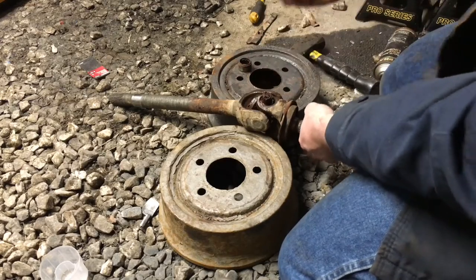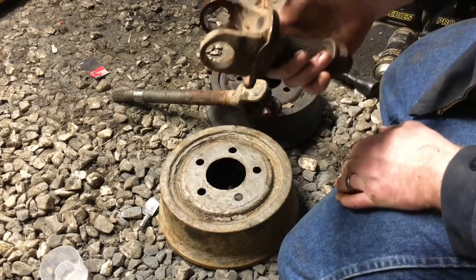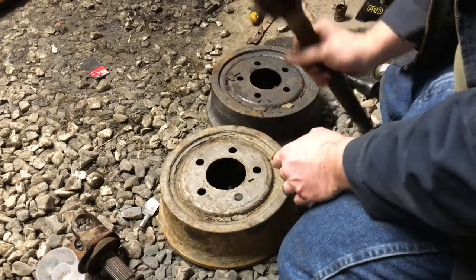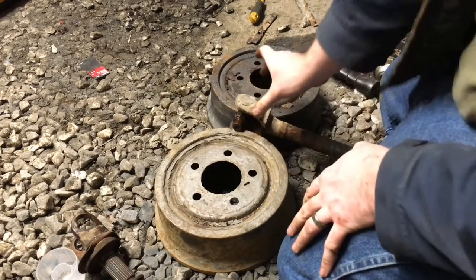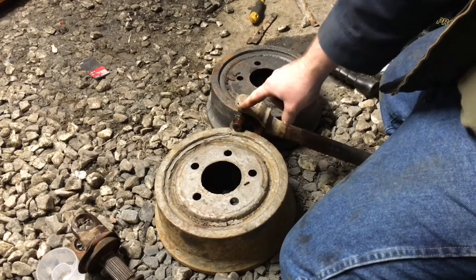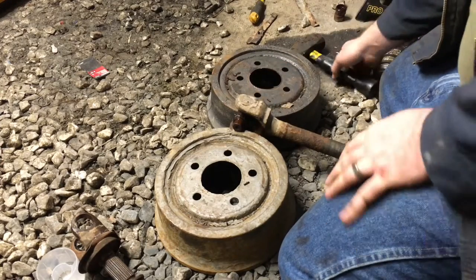Second cap. And you should be able to just go ahead and take your outer stub off — pretty self-explanatory. This is where having two hard surfaces comes in handy — it holds everything in place. I recommend beating back here, not up here, because if you're beating on this with a socket you risk damaging the edge. I've seen people do it on the trail and they couldn't get the u-joint cap back in.